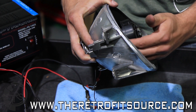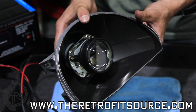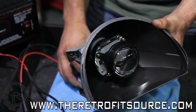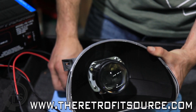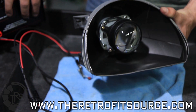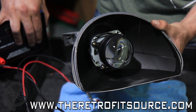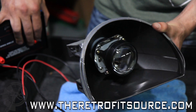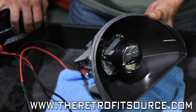Also, during installation, make sure you don't bump the solenoid assembly or the cutoff shield to ensure its proper function for long-term use. We recommend using a 9 volt battery or an assembly tester like this to test fire the solenoid to ensure proper function. You're going to want to test fire this 30 to 40 times to be absolutely sure before you seal everything back up that it works properly. You'll be able to hear and see the shield move and ensure that it's not stuck.